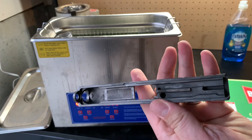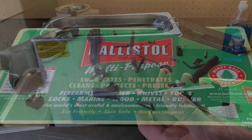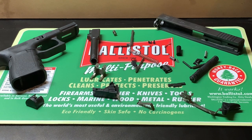I'm going to repeat the drying process off camera on all the parts until everything is dry. Once all parts are washed and dried, I want to reiterate: make sure everything is thoroughly, thoroughly dried. You do not want water left over inside any of these parts. If you don't have an air compressor, a hair dryer works — I've seen a lot of people do that, though it takes a lot longer. An air compressor doesn't have to cost very much; you can get little ones good enough for this job at places like Harbor Freight for as low as $40 to $50.